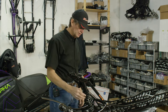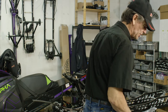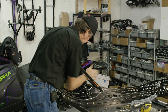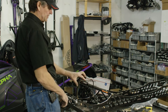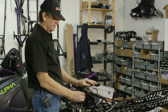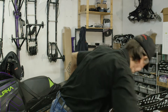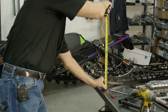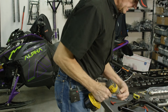That's the front shock and front arm installed. Then loosen up this spring really loose because we want to set our strap adjustment before we set the spring adjustment. For most sleds, we wrap this around and go in the third hole from the top on the front side, and the second hole on the back. That's for the majority of suspensions — that's where you'll set the initial. That should give us around a 12 to 12 and a half inch default setting, which it does. That's in the instructions with the photo.